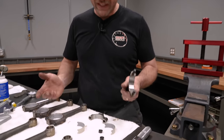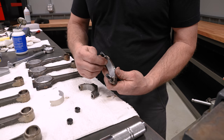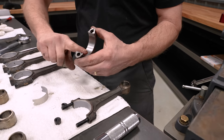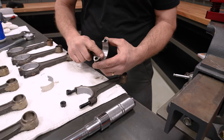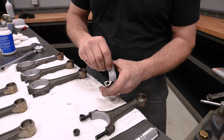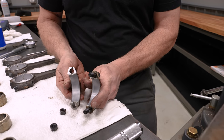What I'm doing is I'm going to pre-assemble the rods with the bearing halves in them. It's pretty straightforward and easy. You have a little tang on them — you line them up and slide it down in. And then of course the same thing on the cap. I always use my fingers, but make sure there's no lint or dirt in between the two surfaces, because that will change what your ID is going to measure.